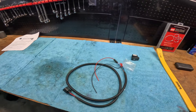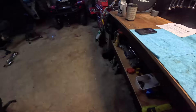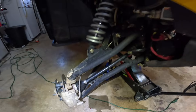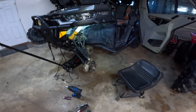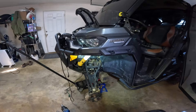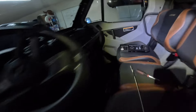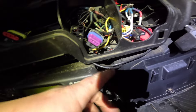We're back the next morning — got a little too late so I decided to finish up today. All we've got left is this wire harness. We've put all the suspension back together — everything but the left shock is out, and I'll show you why in just a second. Now we've got to route this wire harness. Take your shock out and then take your console out — that's super simple, you just pull on the bottom, the tabs will pull up, then you disconnect all the wires. Now we're going to route all the wiring into the new switch for the four-wheel drive locker. We've got to get through the firewall — the easiest way on Limiteds is this shifter cable hole right here. We're going to pop this little button head out, pull this panel off, and we'll be able to work our wires through.